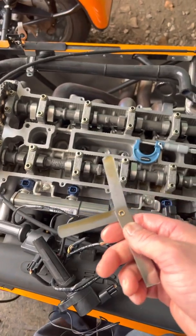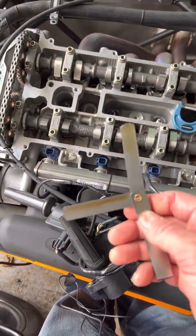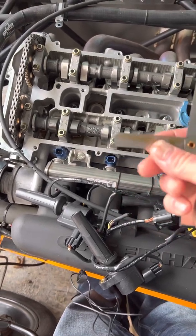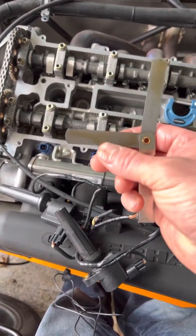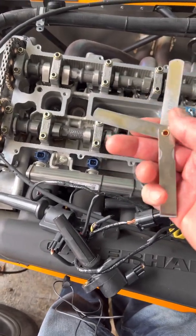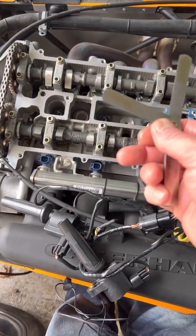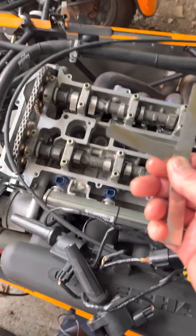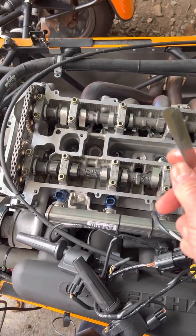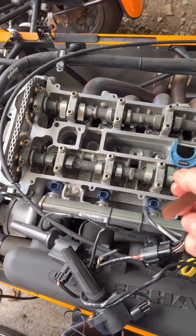A quick insight into valve lashing. Once you're finished with your thickness gauges, leave them oily — they're steel and they will rust, and once rust expands the gauge is no longer fit for purpose. Keep them in oil, store them in a plastic bag, and keep them dry.